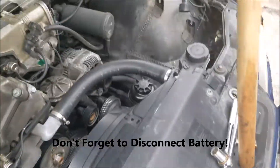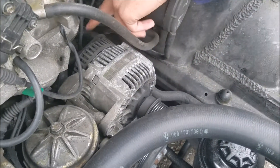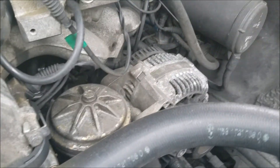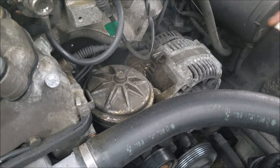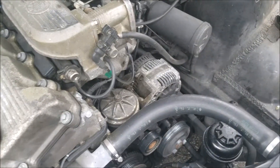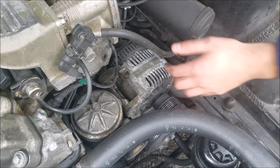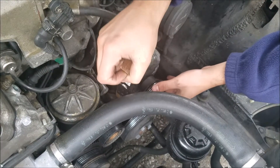Next step is to pull out the alternator. It's got a big red wire and a small black one, and that's it. But you can't really get to it while it's still attached, so I'd rather pull it out first and then get to the wiring, because this wire here has a little bit of pull. What I do is take some PB Blaster and get it in this area right here — you'll understand why in a minute because it is usually a pain to get these things in and out. When you bolt it in, it's got these two little pistons on the inside of the alternator that compress into the bracket. I got my tool and look at that — that was pretty easy.